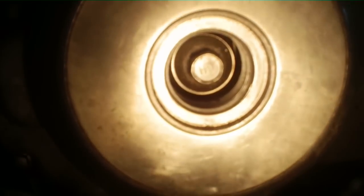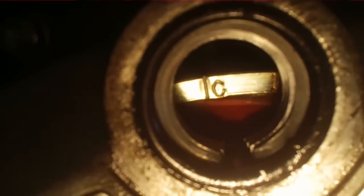Okay, everybody, this bolt right here, you get in there and you turn that bolt, which turns your cams and everything. I don't know if you can see it or not, but inside there's a line and a C. Gotta hold the camera sideways to see it. There's a little line and a C, which means top dead center. So I gotta come over just a hair more. There, it's clear. And then we'll have it top dead center.